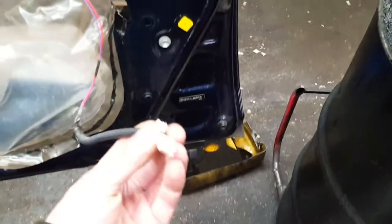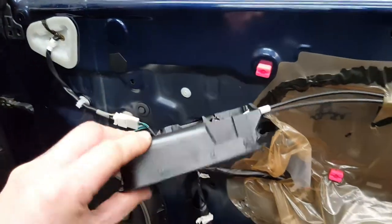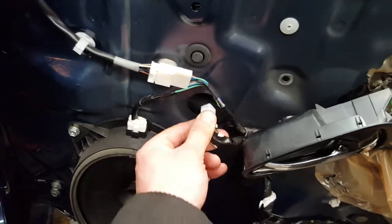Once that's done, you need to remove this little plug from the light — just squeeze it and remove it. This fitting you just turn and it will come through the cover, nice and easy. That's the other plug going into the motor itself, which is behind there. As you can see, that's the motor and that's where the plug goes.